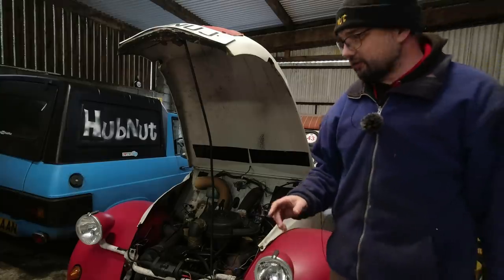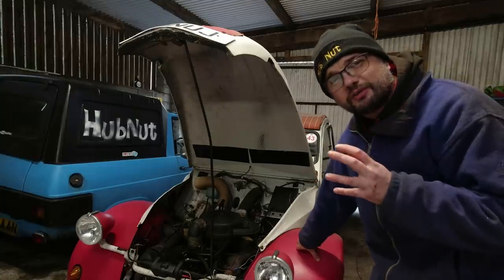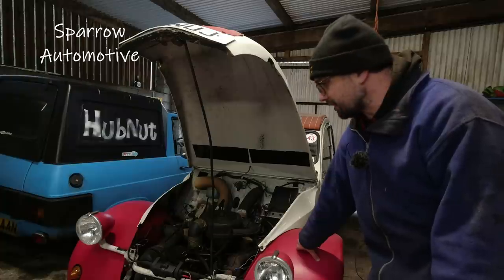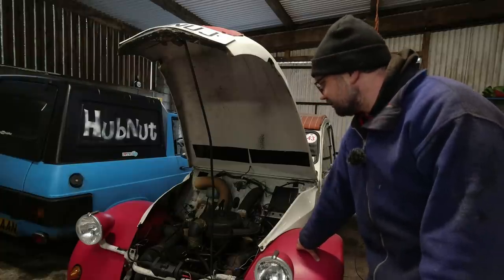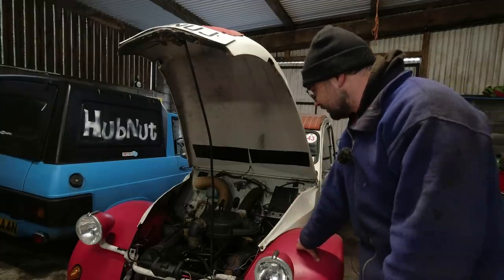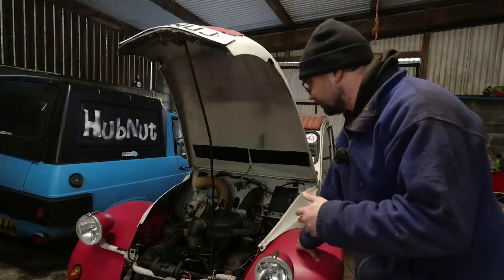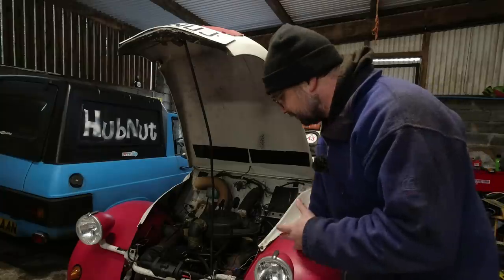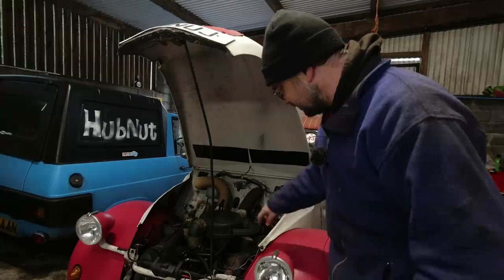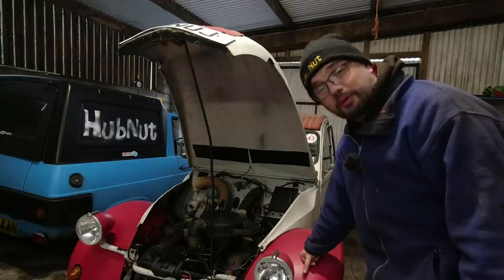The reason I have a spare crossbox is this engine produces a very strange resonance at higher revs. Me and Pete Sparrow have puzzled about this. If it's puzzling Pete, it must be puzzling. We don't think it's the engine itself - we think the resonance may actually be in the exhaust crossbox. So if the heat exchangers are coming off, the crossbox might as well come off too. And while I don't have to remove the wings, I think it just makes life easier, especially getting at the inlet manifold bolts. So I'm going to go for it and get the bodywork off.